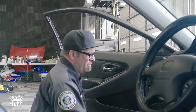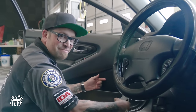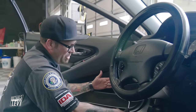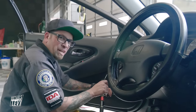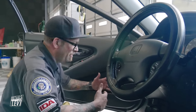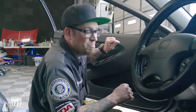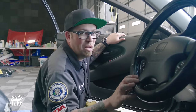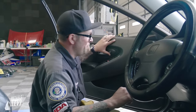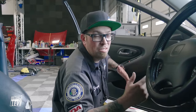What do you do about blowing compressed air in the speaker grills? My hand is at an angle, therefore the air is at an angle, and I'm basically brushing at an angle. If you put your hand in front of it you can actually feel the amount of pressure that's realistically hitting the speaker. I'm not sticking this straight in pulling the trigger to blow holes through the filters. Also, you're probably wondering why the window's down - if you don't keep at least one window down while working on the interior, your hand can hit the lock button and you can accidentally lock yourself out.